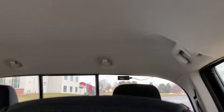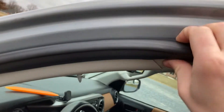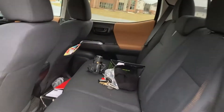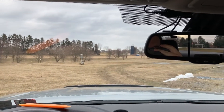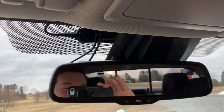Because Thinkware sent me the two-way camera system, I also have a rear camera. What I did was remove the weather stripping and wired the cable all the way through the stripping, through that panel, through the back weather stripping on my door, and then tucked it in between and up through the headliner. It is a little bit of a process, but it wasn't incredibly difficult. If you have about half an hour to 40 minutes on a Saturday, it is a very clean-looking install that hides the wires well. Sitting in the cab, I don't even see the dash camera — just two small wires.